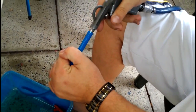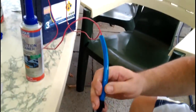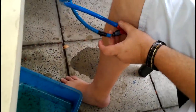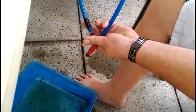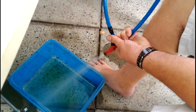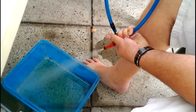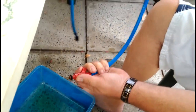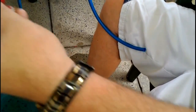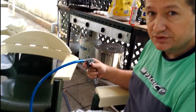I actually go a touch over three bar. Then I test to make sure the hose doesn't blow off under that pressure. I grab the injector, put it on — softly to start — keeping the pressure up while going, then wriggle it until I run out of cleaner and until the nozzle reaches the required spray pattern. I'm really happy with this one — I've done it a few times already. After it's empty, you pop it off. I've probably done them about six times to get the desired effect; they all look identical in spray pattern now. I'll do them one more time before installing them.